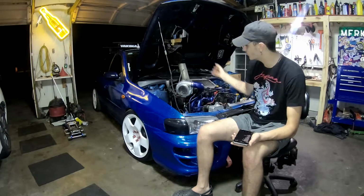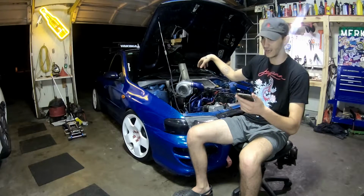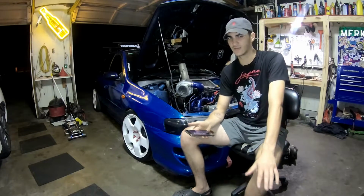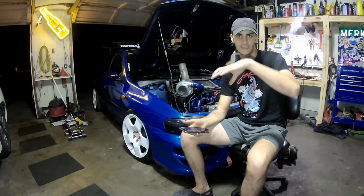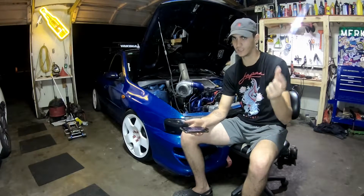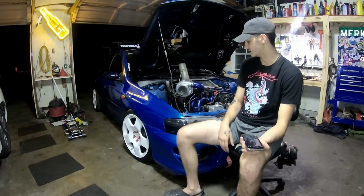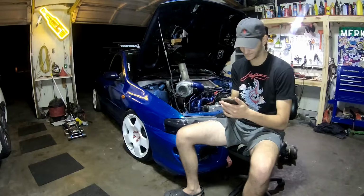And then if we move to the exhaust portion, the wastegate, I got a 48 millimeter wastegate, I think. I'll add it in if I'm wrong. But I also got that wastegate for 50 bucks on eBay. I've heard that they leak sometimes, so you want to take the top off and make sure it's all good. You may want to adjust the spring if you're just going to run wastegate pressure. But so far it works for me. Literally just welded it straight on to the exhaust, so it works just fine. I got the dump right there, right next to the big exhaust.